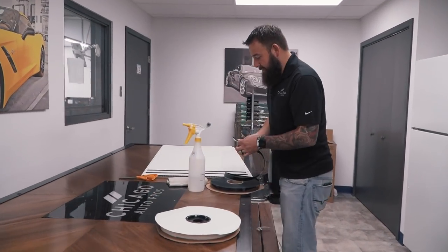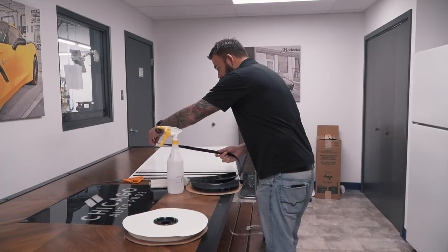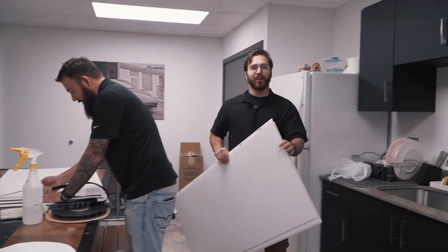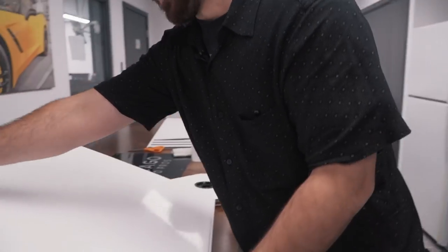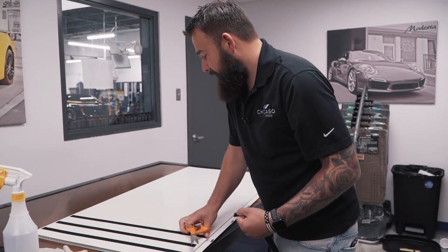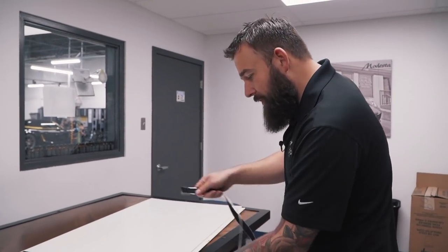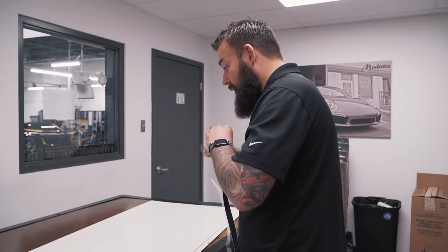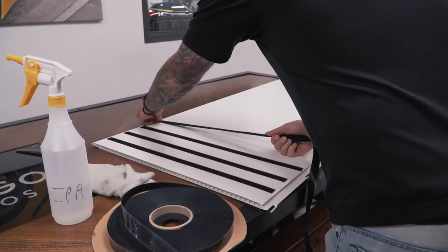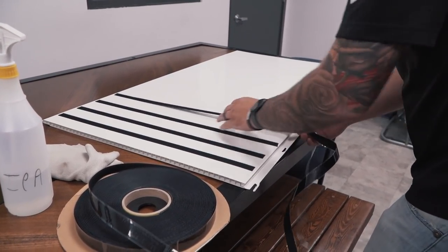What's that? I'm making a pad cleaning board. This is a bunch of Velcro, so we can stick the pads on this and then use a pressure washer to clean it. Arts and crafts. Trying to make it a little easier to clean the pads. Right now they just take the pad and put it on the ground. We have an old WeatherTech mat that they put it on and then they have to bend over or hold it and pressure wash all the old compound residue and polish residue out. I'm hoping you can stick like 30 pads on here and then use the pressure washer, just stick them all to it and then pressure wash them out.